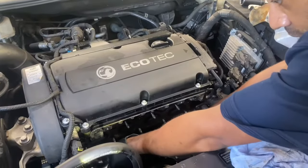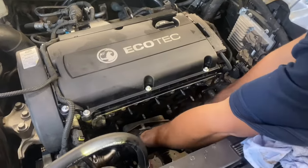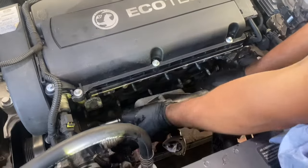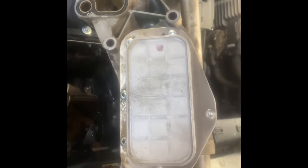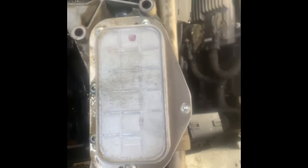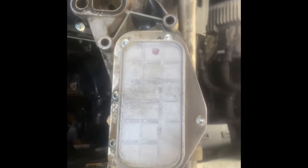After you've finished removing the bolts on the oil cooler, literally just give it a little wiggle and a little tug and it should just pop off. Now the oil filter cooler housing is all out. To remove the cooler, you literally have to take the housing out because the bolts are situated backwards, so you have to take the cooler out to actually get access to them. Remove the seals - the seals on the cooler are these ones. I'm also going to replace the ones on the oil filter housing as well, as we've got both of them there.